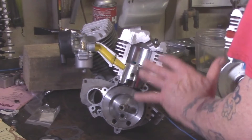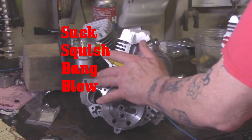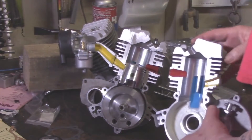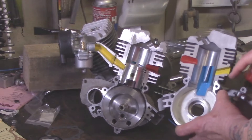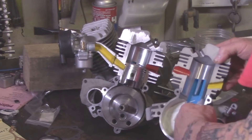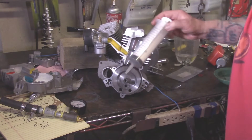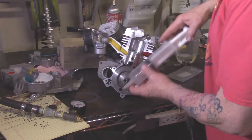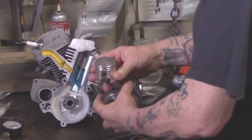This isn't the first thing you're going to check, but this is the first item on our list — sucking — referring to how we're sucking in air and fuel at the intake. This is an engine I cut in half, so it's a mirror image. The yellow area is your intake, the red area is your exhaust, the blue areas are your transfer ports, and the white area is where your crank assembly rides. It works very similar to this syringe — when I pull up on the plunger it creates a vacuum and sucks liquid or air in.